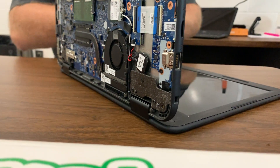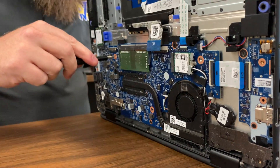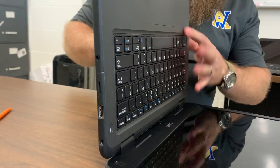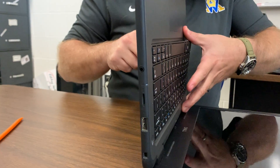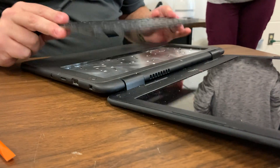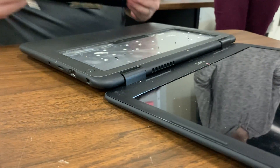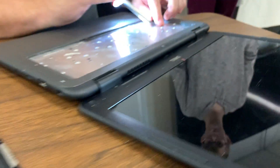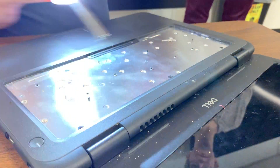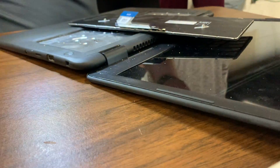What I like to do — and this makes it a lot easier — is use the same tool I use to take everything apart and insert it directly into the screw holes, here and here. I'm going to insert into the screw hole, use my hand to put pressure on the edges, and push so it releases. Do the same thing for the other side — push, release. Once it releases, you can pop it up the rest of the way and it comes directly out. You can see these little notches on top, which means it has to be inserted a specific way. There are little pins that stick up all across here, and those fit into holes to pop it down and keep it in place, instead of being screwed down like they used to be.